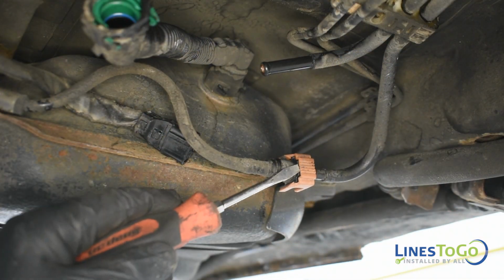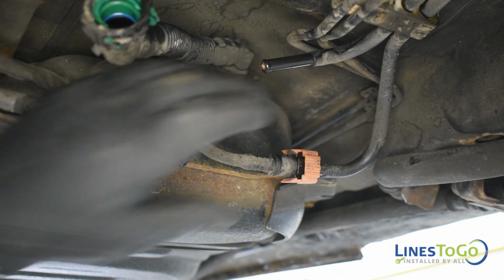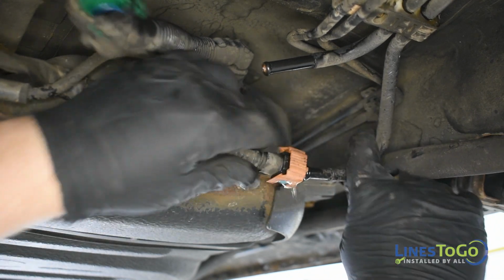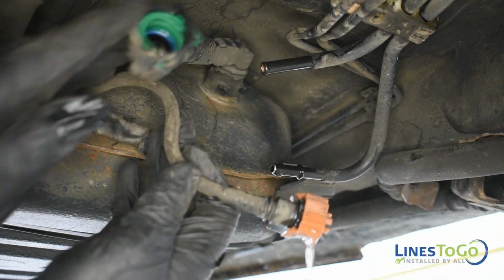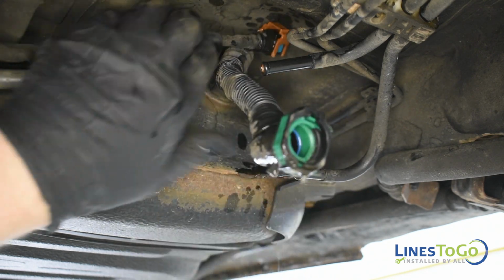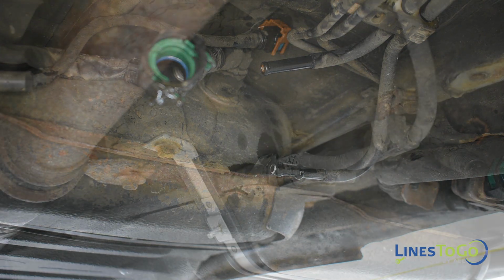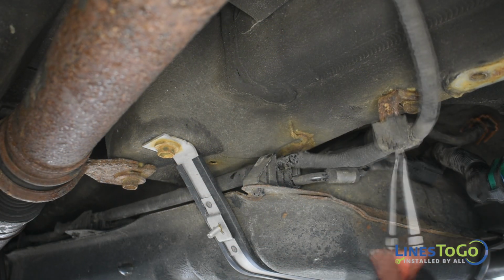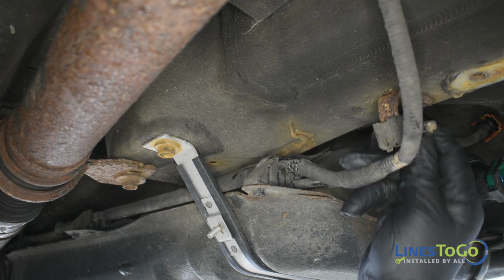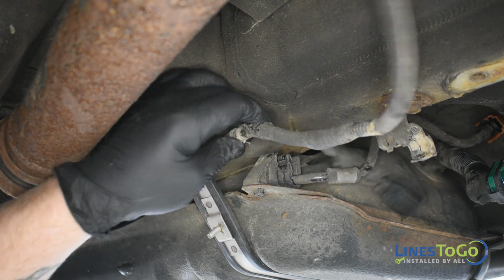At the front of the fuel tank, disconnect the fuel supply quick connect fitting by opening the safety clip and depressing the 2 plastic tabs to disconnect it. Reposition the nylon supply line attached to the fuel tank so it is pointed upwards to minimize any fuel loss. Use a flat blade screwdriver to remove the fuel tank wiring harness from the plastic clip located in front of the fuel tank, along with the 2 front clips on the fuel tank itself.